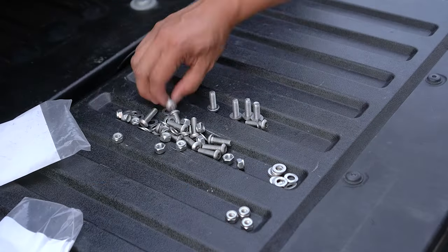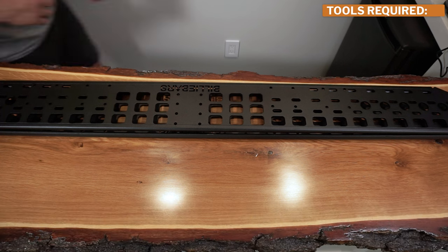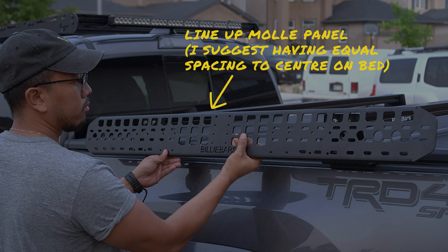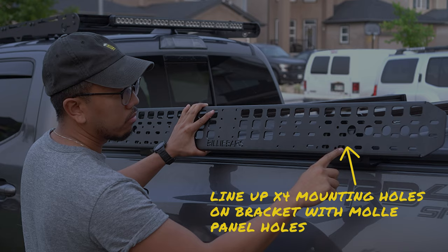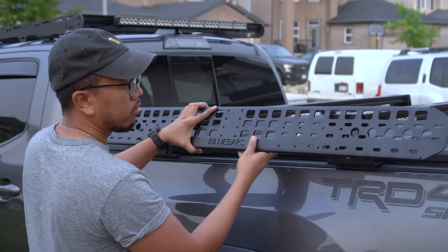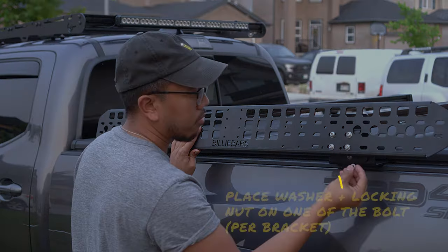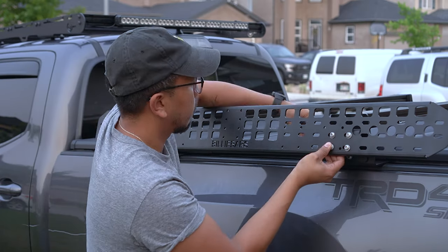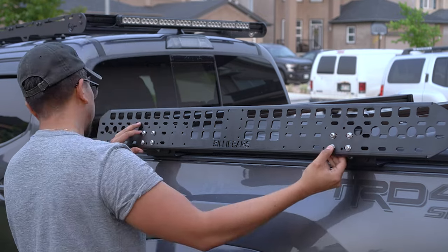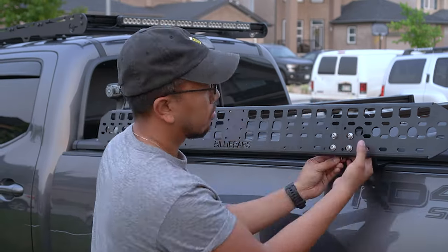That's complete. Prep the other package of mounting hardware for the next step. After installing the MOLLE panel brackets, let's now attach the MOLLE panels themselves. Simply line up the MOLLE panels to the brackets — the measurements from the start allow for the panels to be centered along the truck bed. You'll need to line up the 4 mounting holes for the MOLLE panels and 2 mounting holes for the crossbars. Grab 8 bolts with locking nuts and place all the bolts to hold the panel in place. Then place a washer and locking nut on one bolt of each bracket and tie these in first to fully secure the MOLLE panels. Make your final adjustments and use the drill with a 3/8 wrench combo to tie in the bolts. Repeat for the rest of the bolts and the other panel.